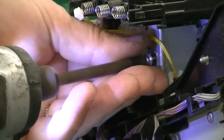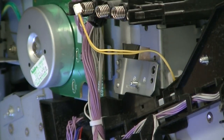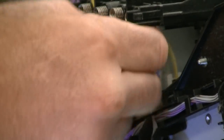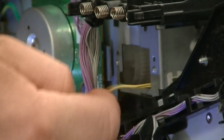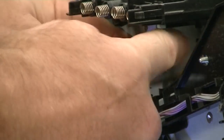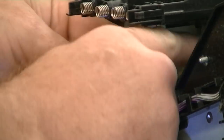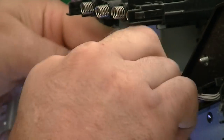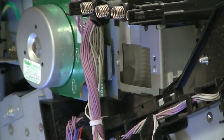Revealed — we see two screws. Those two screws release the plate, the secret access panel. Those are normal screws, and out comes the solenoid. It can be a little tricky to get it out of that connector area. There's a channel, and if you apply downward pressure it comes right out of the channel. Just like that, and then you get your connector in and feed it back out through. And you're done — you've got it.